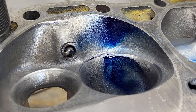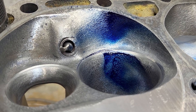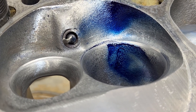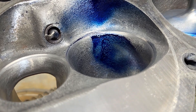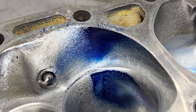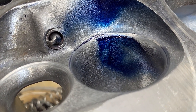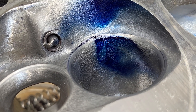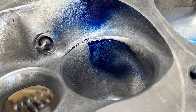What I did is I changed our ramp angle even more, more similar to an L29, but not quite there yet. I don't know if I can do it because I finally started to show some thickness issues on that ramp side. And the way the burr wants to go as you're moving that ramp, it wants to dig this way, which can cause a problem.